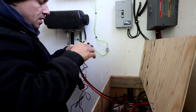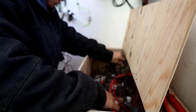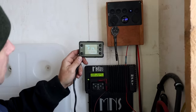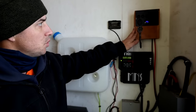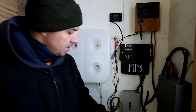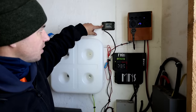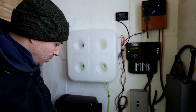Let's see if we can get any power. She's on — the controller — that's power for the diesel heater. We got juice. We're getting there. How we have this hooked up: there's a really cool switch panel wired into the battery that gives power to all the switches. We hooked the diesel heater up to the second switch. If I turn it on, we've got the controller over here. We're not going to turn it on yet because we're not ready, but it's wired and ready to go.